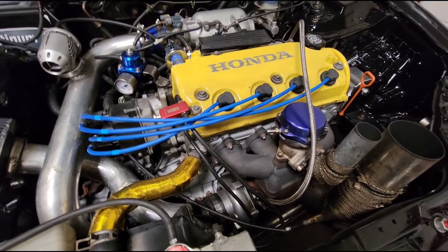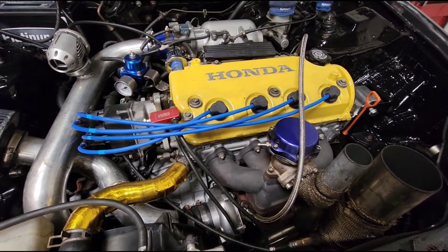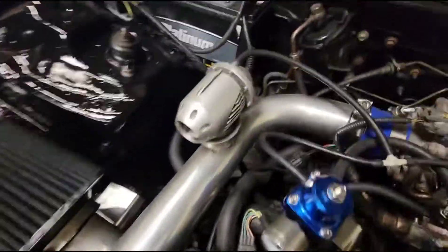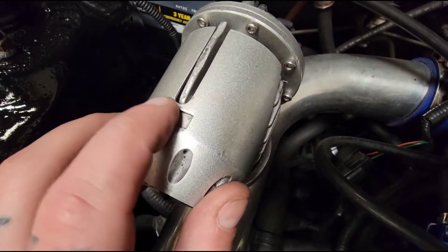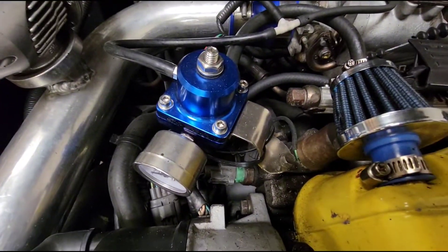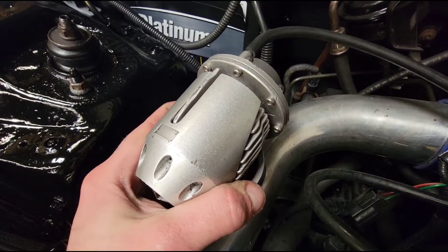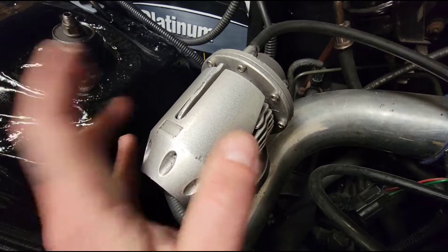That's typically on an engine that's built very loosely or one that's on its last leg. There's other stuff too — I don't know if this is a genuine HKS blow-off valve. The emblem isn't on it, the wastegate is knockoff, the mounts are knockoff, the fuel regulator is knockoff, so I'm going to assume this is knockoff as well. A big problem with these knockoff blow-off valves is they spin and move very easily, which means they're ultimately going to leak boost.